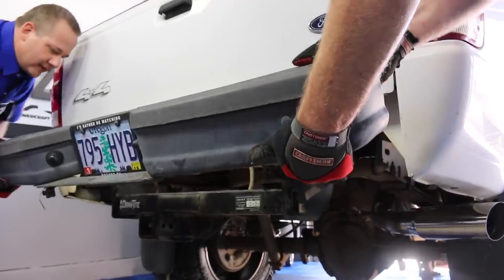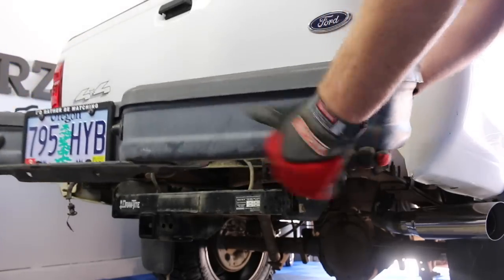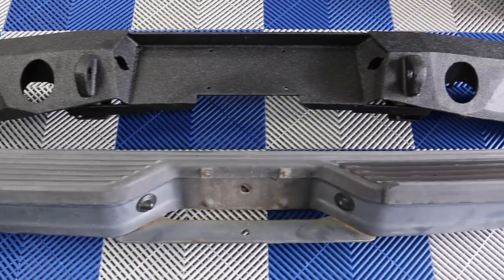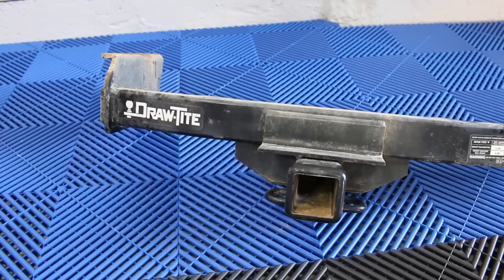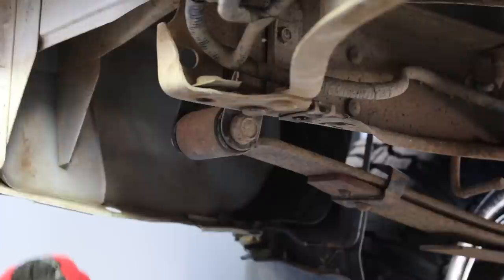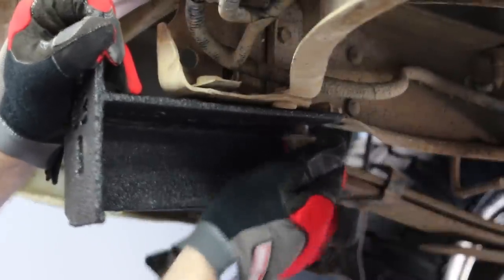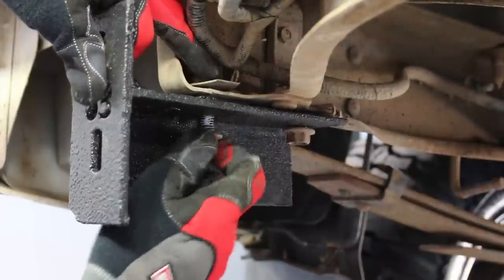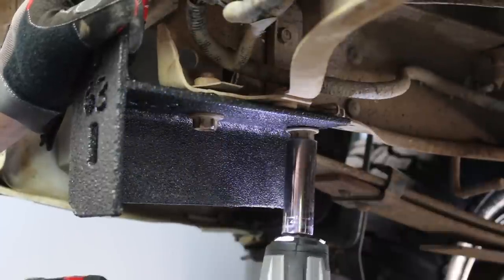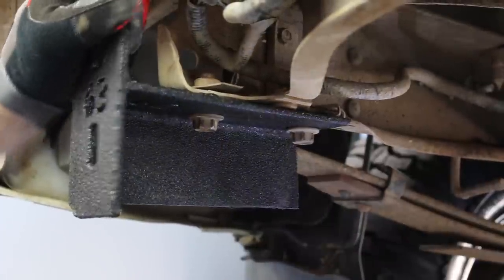I just love the sound of ripping off old parts! Now, like the front bumper, the rear was also easy to remove. Check out the difference between the two — there's just no comparison. The rear hitch wasn't compatible with the bumper, so we'll have to figure out another solution later. Installing the two rear brackets is easy, just like the front, using the factory hardware. I recommend you not tighten them all the way down — give it some wiggle room until you get the bumper on, then seal the deal.